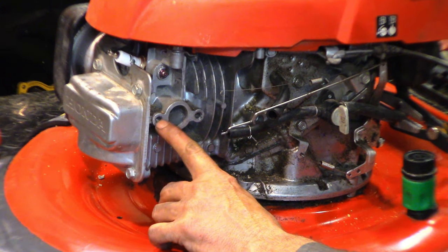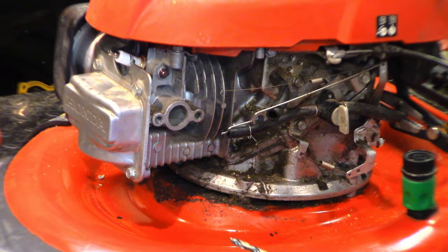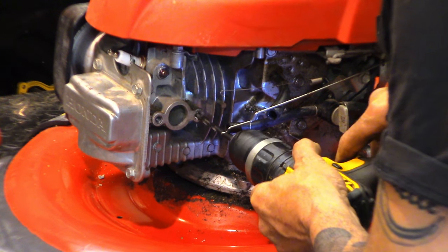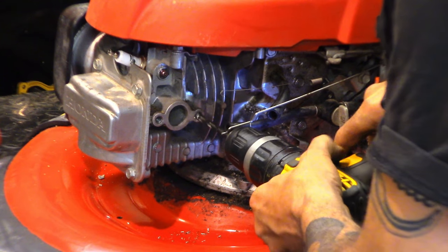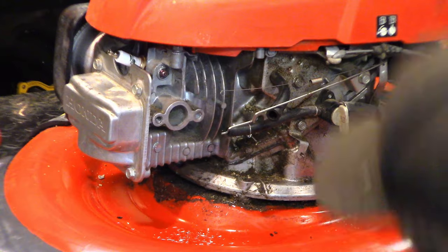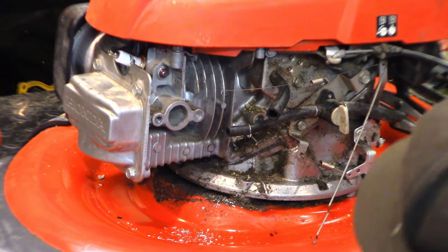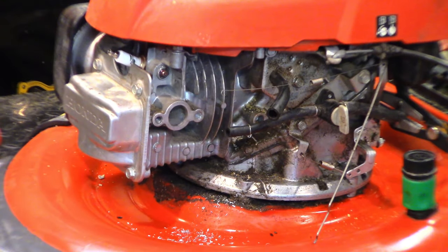These threads are crusty. I'm gonna blow them out. These ones are missing. There's nothing in there. So the drill size on the kit says 1/4 inch, so let's give her. What's the worst that's gonna happen? I don't wanna go too deep, but there is a lot of metal there. There, got to the point where it just touches the cylinder. We're gonna go with it.